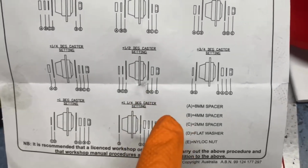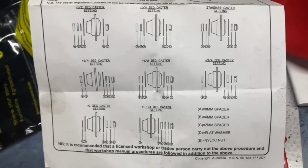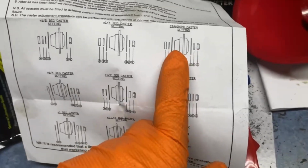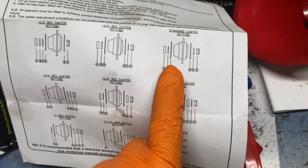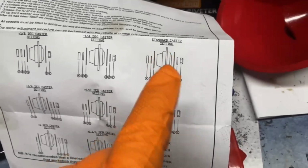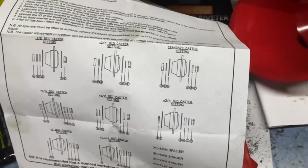I'll leave a link in the description below to Whiteline's preferred settings, I guess. Somebody on the GTO forums said that our factory caster for 04, 06 GTOs is somewhere between -6.5 and -8, I believe. But like I said, I will leave that down in the description below. But I will be starting out at these standard caster settings. So let me get these bushings installed, and I'll take you back under the car.